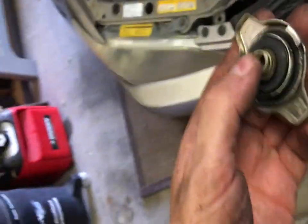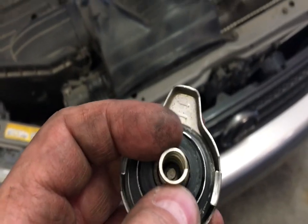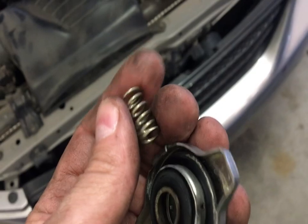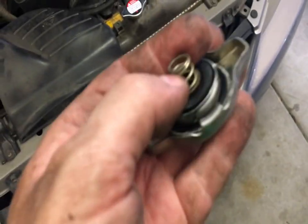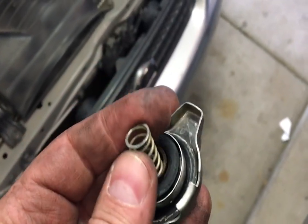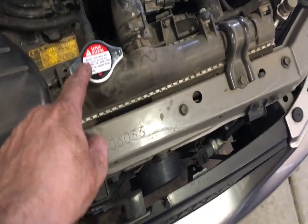After I was done draining the heater core and filling with water, I noticed that the spring came detached from the radiator cap. I looked down and it was actually sitting in the top of the radiator, so I was lucky to be able to fish it out. Just keep an eye out for that — these caps get worn out. What I did was just go get a replacement one. So we're all filled up with distilled water with the replacement cap.